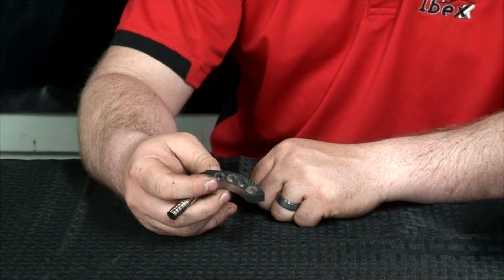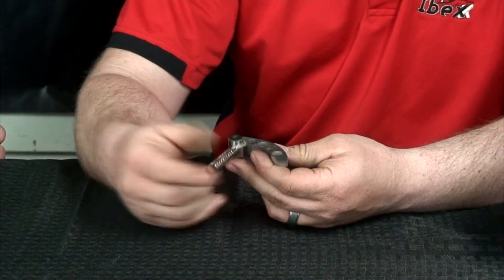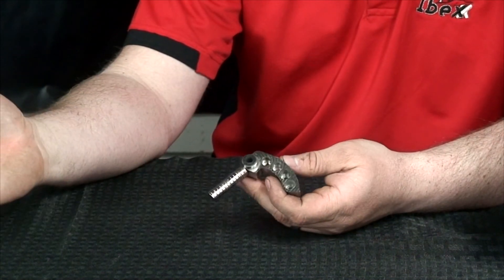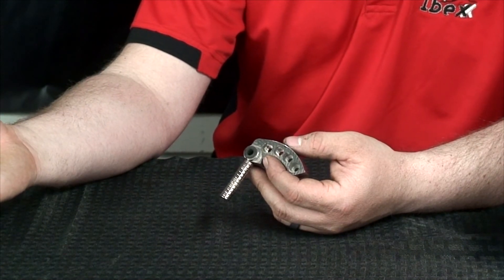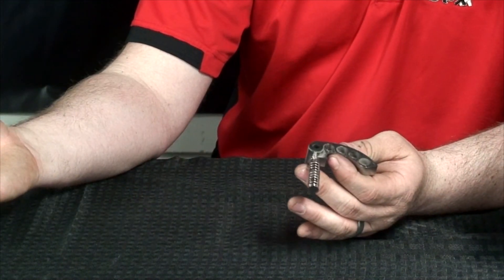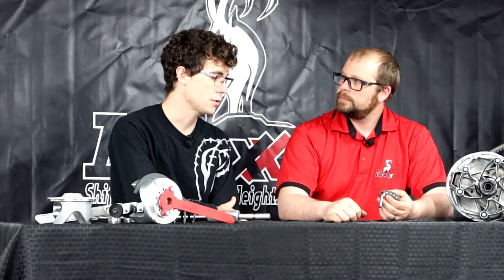With our particular weights, we've designed them such that that's not usually a major issue. What you will normally find is if you put too much weight out at the tip — which is why the rule of thumb is load from the heel first. So if I put all my weight in the tip, what's going to happen? Most likely, on a Razer 1000 for example, you throw all the weight to the tip, take off, and you'll see the tach rip up to like 8700 RPM, which is too high. And then by the time you hit 70 miles an hour, you might be clear down to 7800. So you had too much RPM at the beginning, not enough at the end — you needed to move the weight towards the heel.